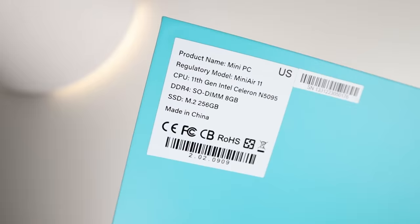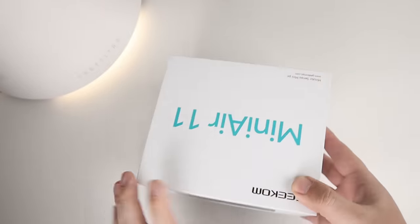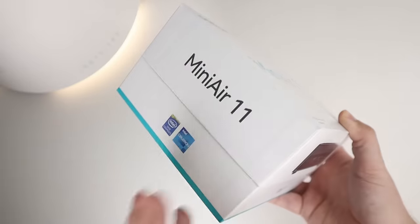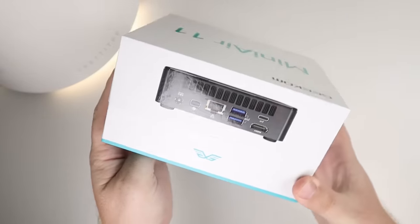If you're going with something budget like this, these little Intel machines are awesome because hardware transcoding on Intel CPUs is generally a pretty good deal. Hardware transcoding is converting media on the fly — such as downscaling something from 4K to 1080p in Plex or Jellyfin while you're on your mobile phone. Now for a quick hardware overview: this is an Intel Celeron N5095 featuring four cores, four threads. This thing is really light, comes in just over a pound. It does have Windows 11 pre-installed on the SSD that I've taken out, and I put a terabyte in here that we're going to be installing Ubuntu Server onto.